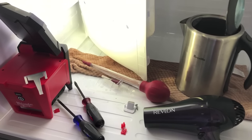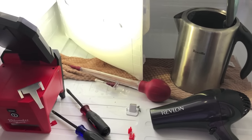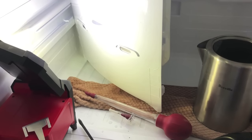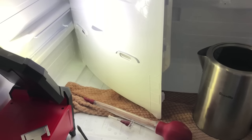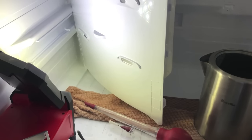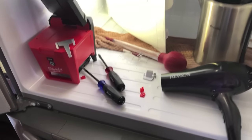I'm here repairing my Samsung refrigerator, which has been filling up the veggie and fruit trays with water. What's happening is there's an evaporator clip that is supposed to keep an ice dam from forming and allow the water to drain out the bottom of the panel. It's freezing and backing up, and then all that moisture finds its way into your fridge. I'm going to go over the tools for this real quick.